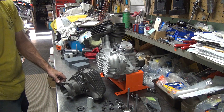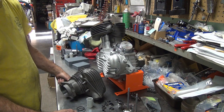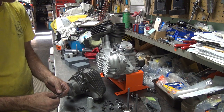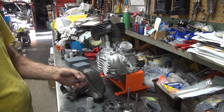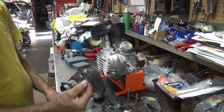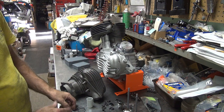Yeah, from a quarter of an inch down. Yeah, we dropped a little bit. Well, so now the back cylinder is what's going to determine it. So now we got the stack of crap on this side. It's 80 thousandths. So that's how thick all the stuff adds up to be in the three gaskets before compression.